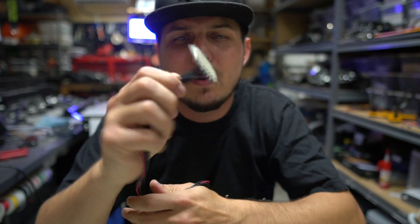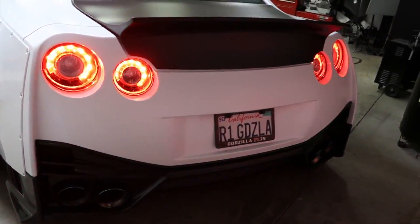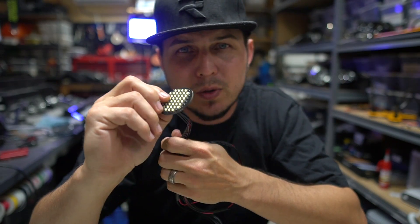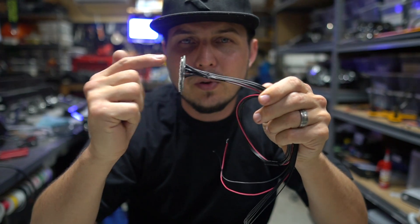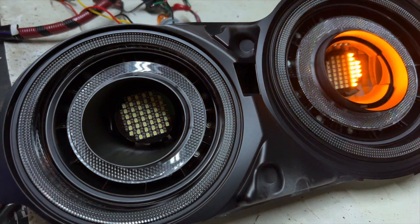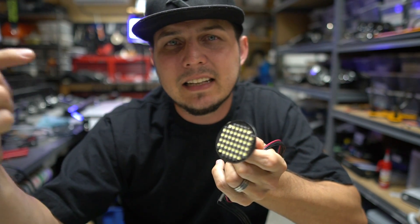First, I want to show you the actual part I'm working with. This is a dual-color little medallion that's totally sequential for turn signals. It's going to a European customer, and in Europe they can't have red turn signals like my typical sequential GTR taillights have. So we're putting these little guys in there — they have all of the white connections bridged together, so there's no sequential feature, but all of the amber individually have little ground channels. If I give them ground and give the whole board power, they will individually do the cool signals. But the problem is it already has power going into the board, so if the car sends power for the reverse lights, it doesn't change anything — it needs to send ground. That's why we're going to convert the signal using the little relay we just built.